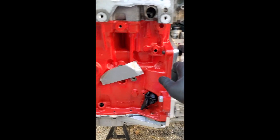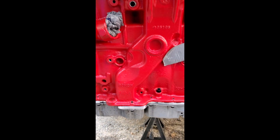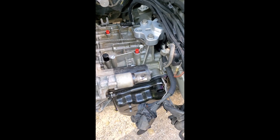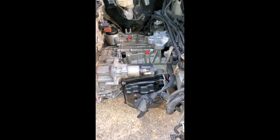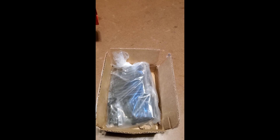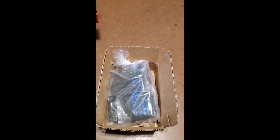We received another shipment of bolts for all the motor mounts to upgrade them to grade 12.9. With the engine bolted in the car, some of the motor mount bolts were grade 8.8 and some 10.9. So I ordered all grade 12.9 hardware for the starters, transmission mounts, and engine mounts.